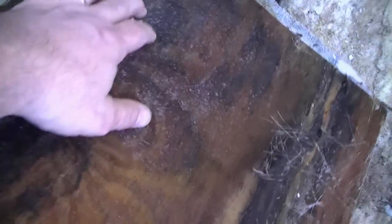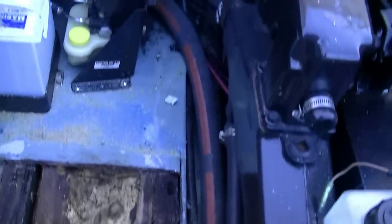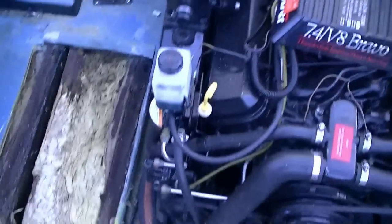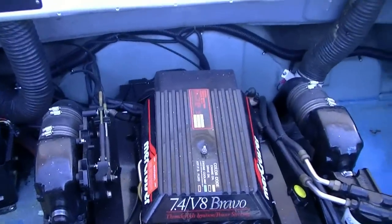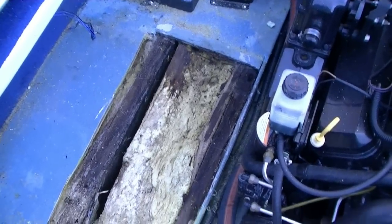You can see this is all just ice. That's the underside of the deck. There's more rotten stringers — it's all the way back. I wouldn't be surprised if we're going to be into the transom, which I know how to do. That's a piece of cake. It's the stringers that scare the crap out of me.